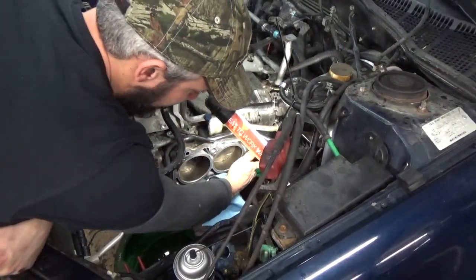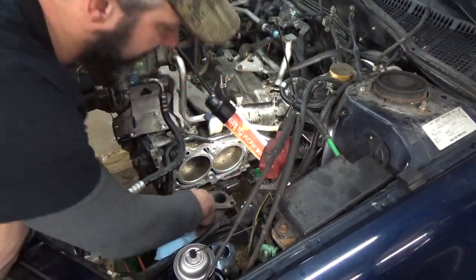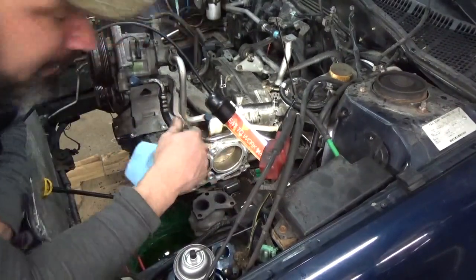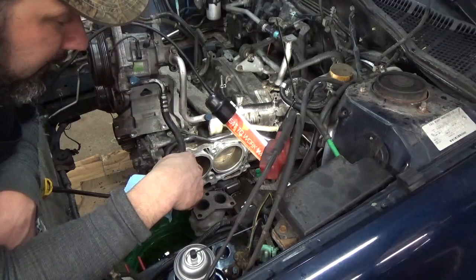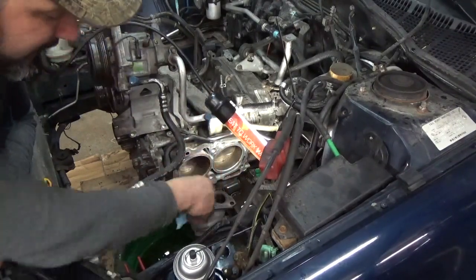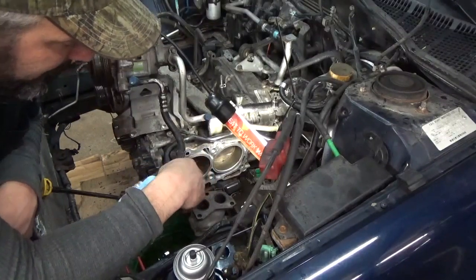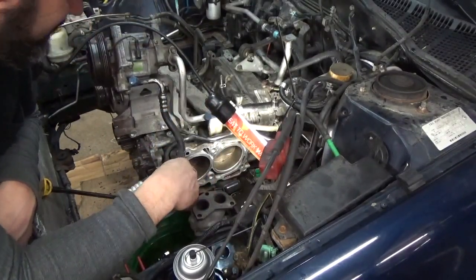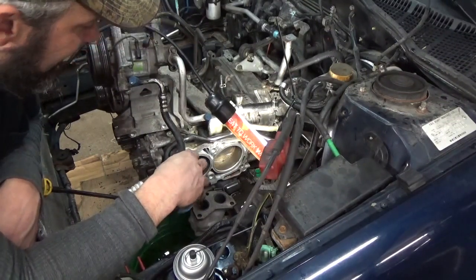I've done it like this for a lot of years and never had any issues. Of course, I do try to cover the exhaust when I'm getting all the initial stuff off, because you don't want anything big dropping down in front of the catalytic converters. The same thing with the oil return side down in the bottom of the block: if you can avoid dropping an acorn or big chunks in there, then by all means do that. Get stuff out of the way.